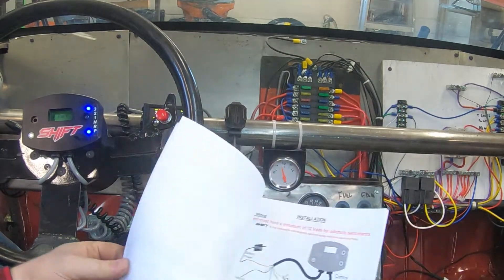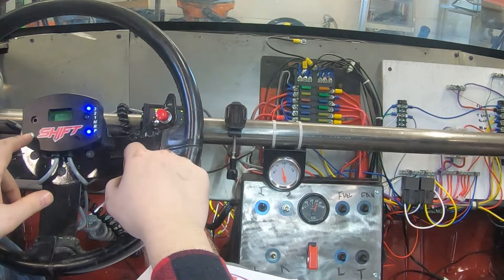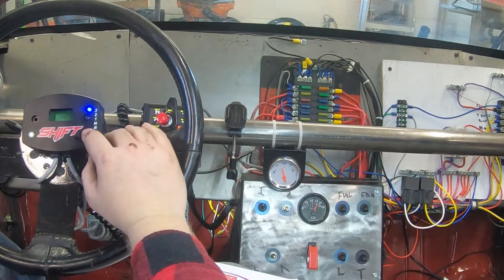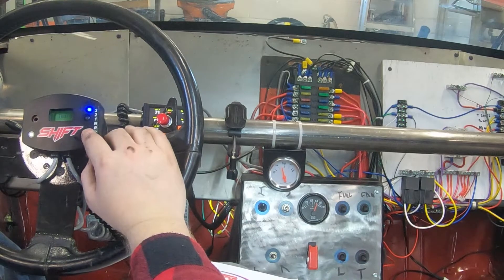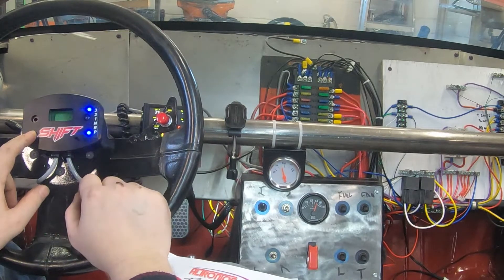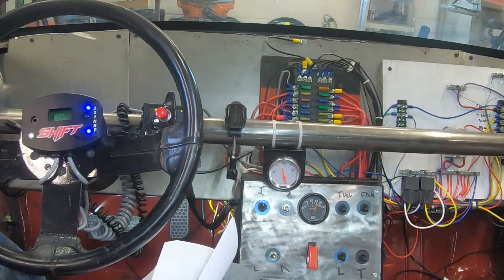Let's see what we got to do here. I'll put this in reverse. Neutral. First. Second. Wow, you can hear that — that's pretty quick. It's pretty much as soon as I push the button, it's shifting into gears. So we can get back to neutral. It doesn't let us into reverse until we hold down the special button, and then we can go into reverse. Can't go into park, can't go into neutral. And now we can go into park. And I can hear the neutral safety switch working over there, clicking off and on. I think we're good to go.